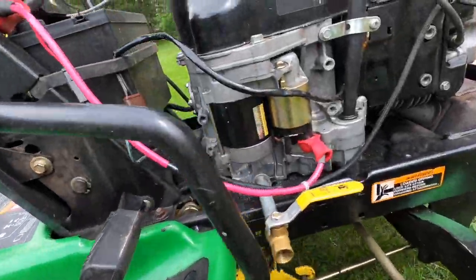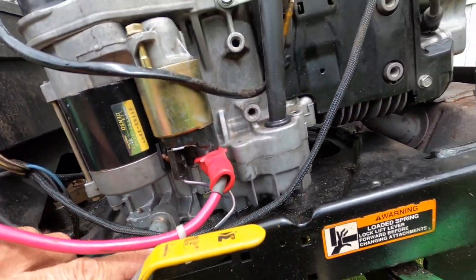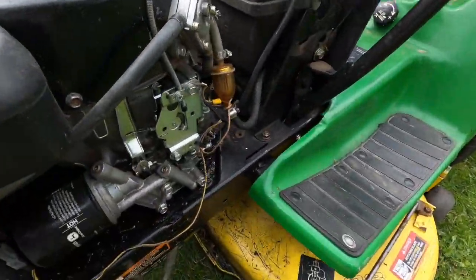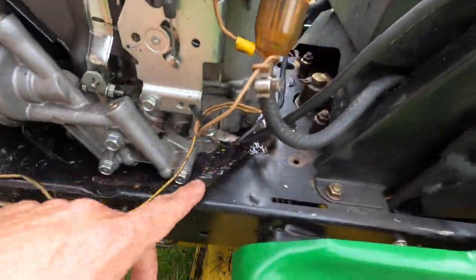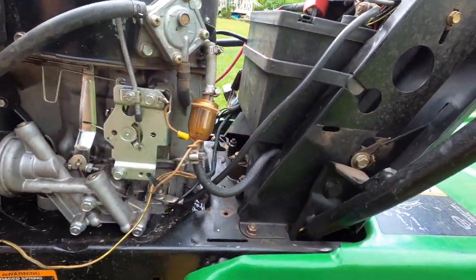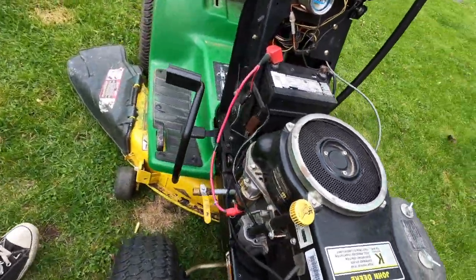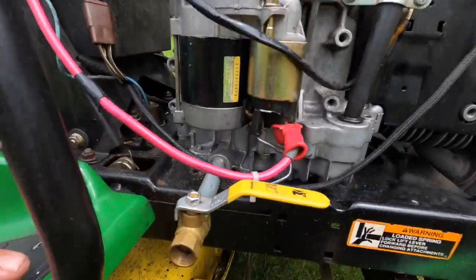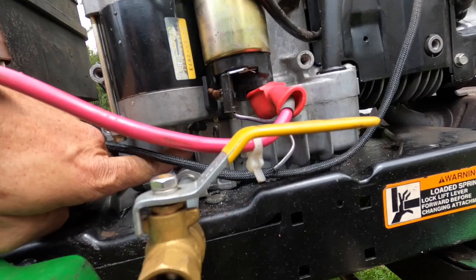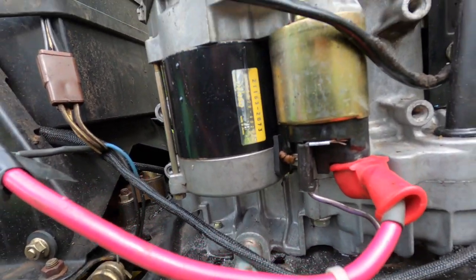That's a good test drive. It did rain this morning, so you're seeing a little bit of condensation and rainwater come off of some of these spots. But I'm happy with that. This is old oil, so I'm going to pull this thing over by the pressure washer, get this all cleaned off completely, and get the hood put back on. Mission accomplished — I'm not seeing any oil down in there one bit back behind that starter where our crack was.